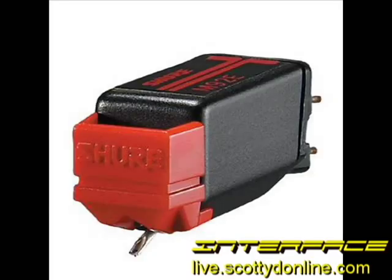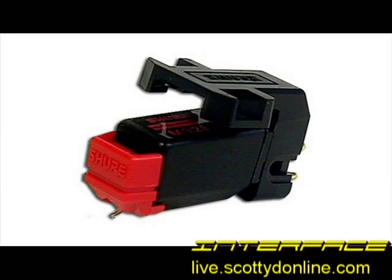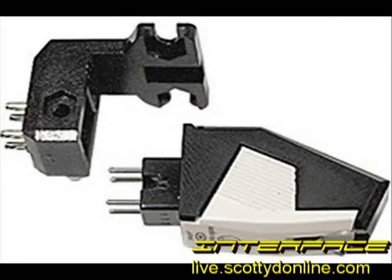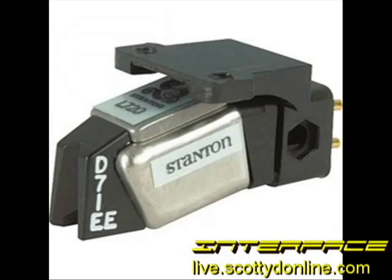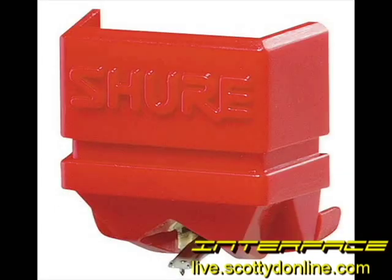Let's take a look at a widely available cartridge that will work on most turntables. The Shure M92E is a fine-sounding entry-level cart that will work with almost any turntable that takes a magnetic cartridge. The audio quality is superb for its modest price, and it includes all the hardware you'll need to mount it on a half-inch tonearm, or you can just plug it right into a P-mount tonearm. Any P-mount cartridge can be mounted on a standard tonearm with an adapter, and Shure includes just such a device with the M92E. Audio-Technica and Stanton also include adapters with their P-mount carts, so this type of system is generally called a universal cartridge. I've tried them all, and I like the sound quality and durability of the Shure the best. Plus, the low price for a genuine Shure replacement stylus is great for anyone doing hi-fi on a budget. There's even a special stylus just for playing back old 78s with wide grooves.